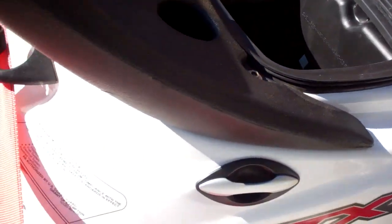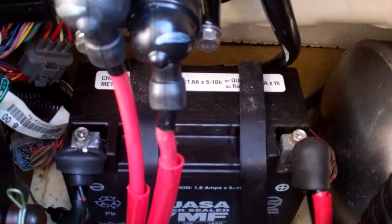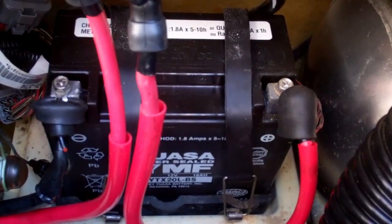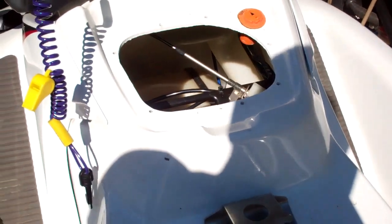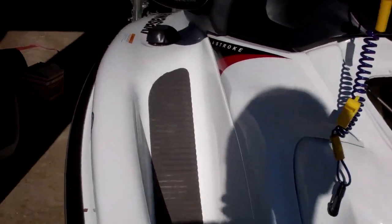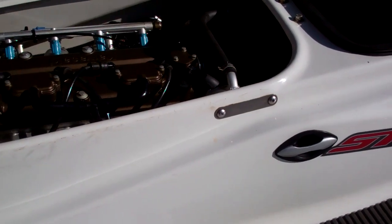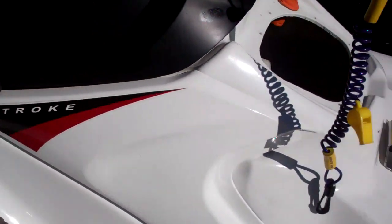The last things I'm going to do: since mine's going to be stored outside, I'm going to go ahead and remove the battery, completely store it inside so it doesn't freeze, and probably throw a charge on it every once in a while — hopefully it'll make it to next year. Next, finish draining all the fuel out that I can get out of the tank. Leave your gas cap loose, not off — that's what the manual says, so I'm going to go with that. And finally, before I put it all back together, I'm going to go ahead and wash it, wax it, put its cover on, pull it out next spring, and hopefully it'll be in just as good a shape as it is now.